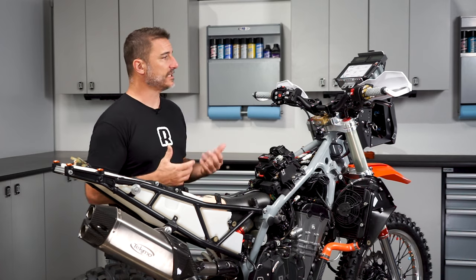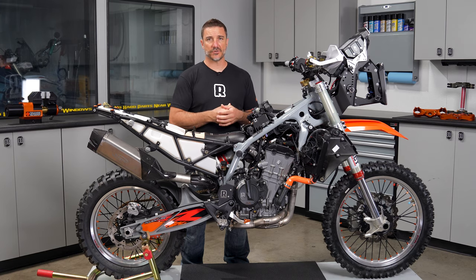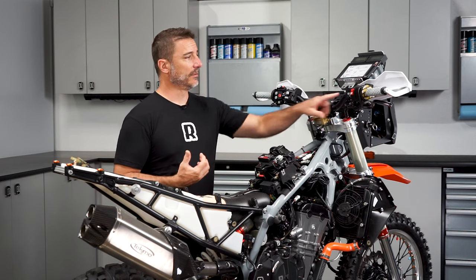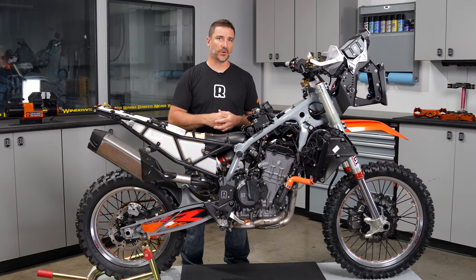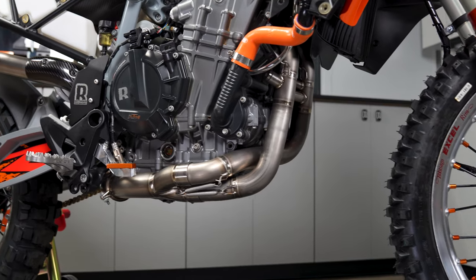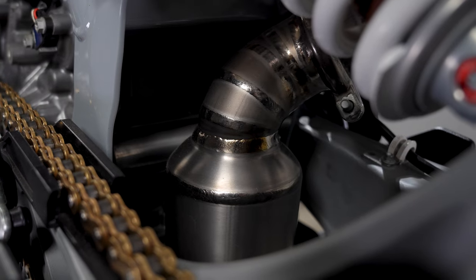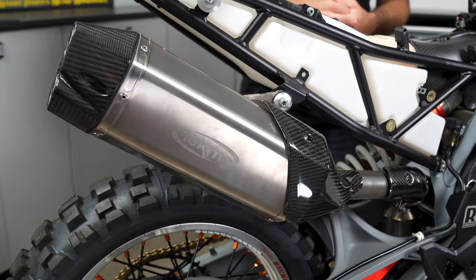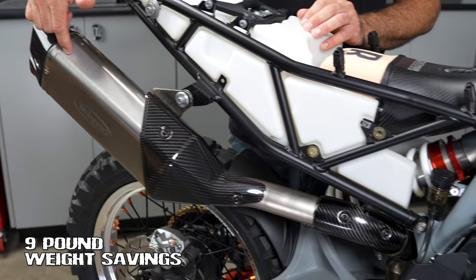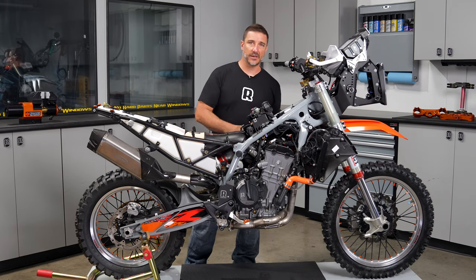The auto-tune gives us flexibility to custom tailor how the bike fuels itself at the flick of a switch. We put a map switch on the handlebars so the rider can set it to tune for racing, economy, or whatever we've configured. When it's off, it defaults back to the base map in the Power Commander 5 and ceases making changes. That's really handy for race days. Past that, we get into our exhaust system — we're running a Tecmo Titanium exhaust, full titanium from the head all the way through the decat and out back. It's a very lightweight, high-quality system. Those are the three systems between air intake, mapping, and exhaust.